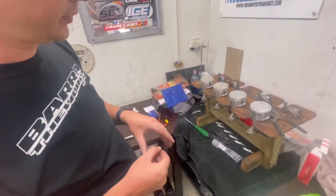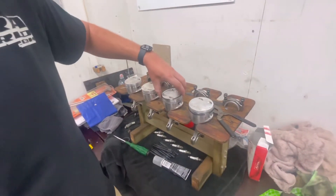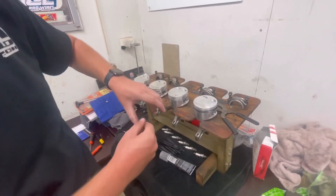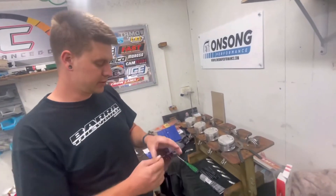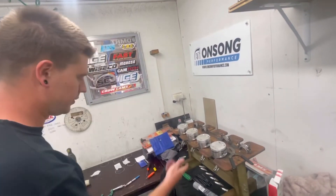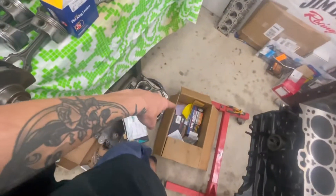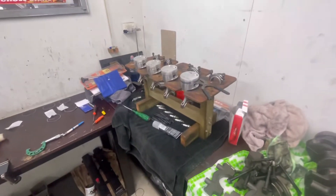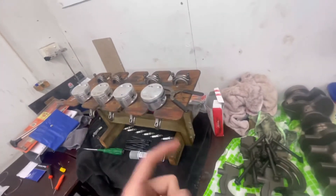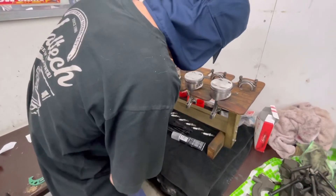Dot to the top. So the oil ring goes at about 5 o'clock or 35 degrees, then you put the top ring at about 2 o'clock — you're basically making sure that none of your ring gaps are lined up. They've got to be opposing as it goes in. The rings will move around once the motor's running, but this is all in the instructions that came with the rings from the ring manufacturer. Don't put them at the dot.